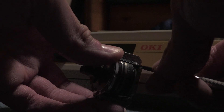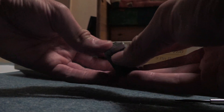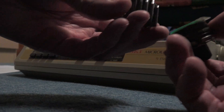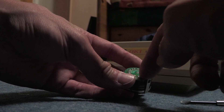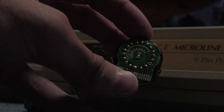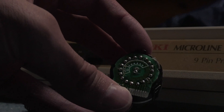I'll see if I can pry that off — I wouldn't be surprised if you're supposed to use a special tool for this. One of them is already undone, and basically the whole thing just falls to pieces. That there is just a big heatsink to help keep it cool. This here is basically some potting compound to attach the circuit board — I think I've had a go at removing this. These connections here are where all the solenoids for the pins are connected. And I think this in the middle — you might notice there's no solder on it — I think that's where the thermistor was, which is probably why it's not showing the error.